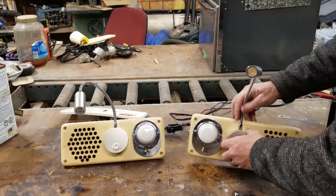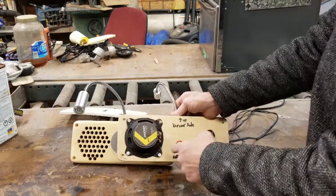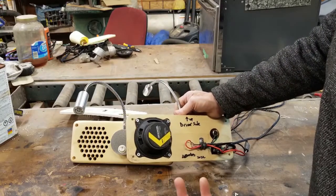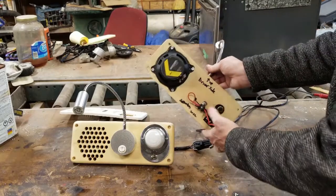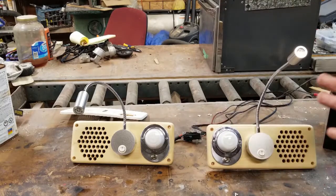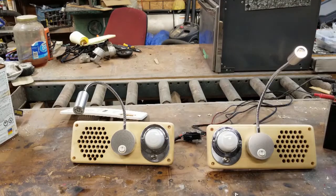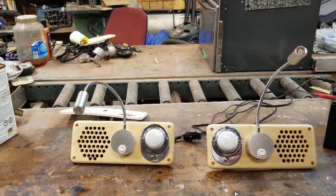On the back, what I did is I routed out holes for the speakers. These are some aftermarket decent little four-inch speakers — they're only four-inch, so what are you going to get. I did the wiring as cleanly as I could manage it. I just have to pull this new set of wires because I don't trust the old factory wires — they're too old. I'll pull new wires and run positive and negative to this setup. I'm rewiring the whole coach anyway.